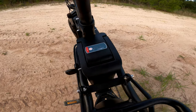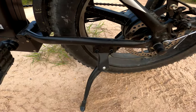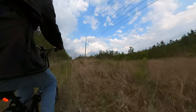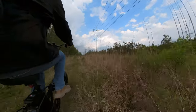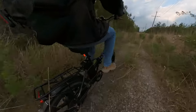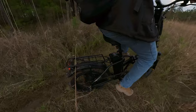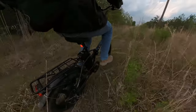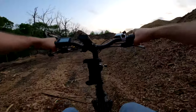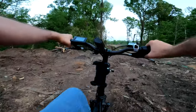Not only does the removable battery lock in and out of the bike, it also has an ignition system on the battery itself, meaning that if you turn it off and remove the key, the bike will be unpowered until the key is reinserted. When in the on position, the key is locked into the battery so you don't have to worry about losing it while out on the trail, and the bike does come with two keys. One area where WTVA got it right that KBO was annoying about is the fact that you can use the throttle while the pedal assist is turned off. This is really handy in low-speed sketchy situations trying to maneuver your way through boggy areas — you can pedal and apply throttle without worrying about the bike jumping you up to a predetermined pedal assist speed. Thank you for doing this, WTVA — they should all be like this.